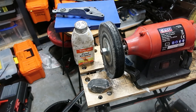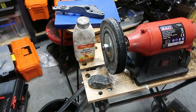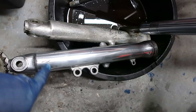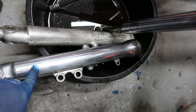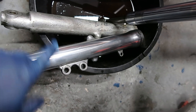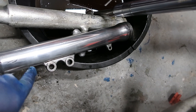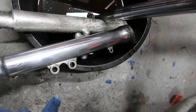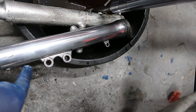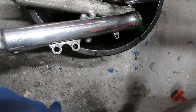It's not a spectator sport, so let me have a go polishing these up and we'll have a look and see what they're like when they're finished. That's about 10 minutes of polishing - it's gone up okay. Maybe spend about 30 minutes per unit. Bench polishing gets the main part done. For areas where you can't get in with the bench polisher, I use a dremel with a small polishing wheel for very localised polishing. Nice and easy - it's not complicated.